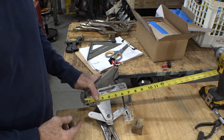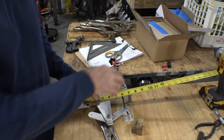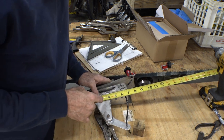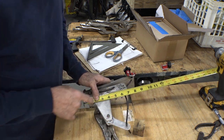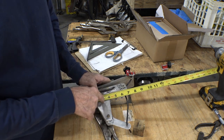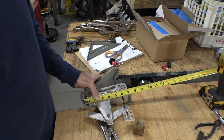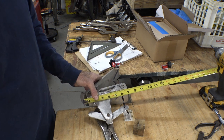What I've ended up with on the throttle pedal linkage: I start with it lined up at the one-inch mark, then pressing down on the throttle pedal all the way — even though this isn't the final rod, it's a little too small for the holes — it ends up nearly at the three-and-a-half-inch mark. You have to trust me on that one; you can't really see it down in there. But I think that's going to work. And as I said, we can adjust the stops as needed to get the travel we need.